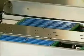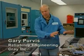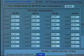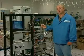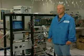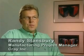This is the Cray Qualification Lab, where we test our hardware components. As you can see, there are numerous thermal and humidity chambers, along with piece part components and large assemblies. On each multi-chip module there are eight die, each with a thermocouple, and we monitor the temperature on each die through our data acquisition system. We also perform up to 6,000 power cycles as our reliability goal, which equates to about 3,000 power on-off cycles for the field customer. We feel very confident that we've uncovered all risks for introducing and producing the SV2.